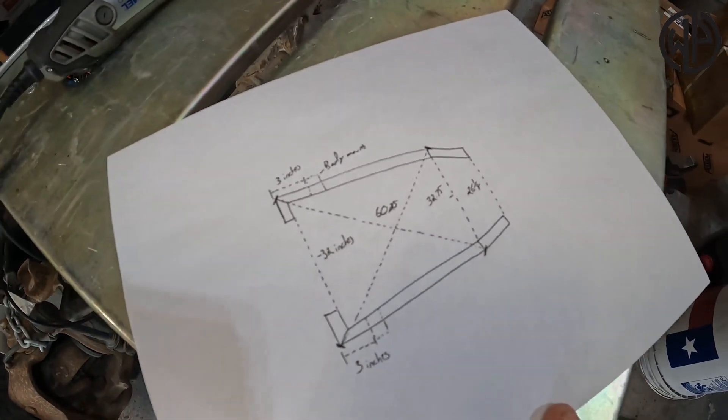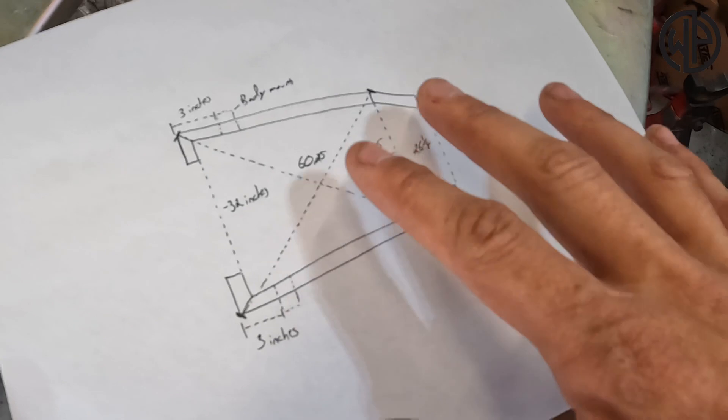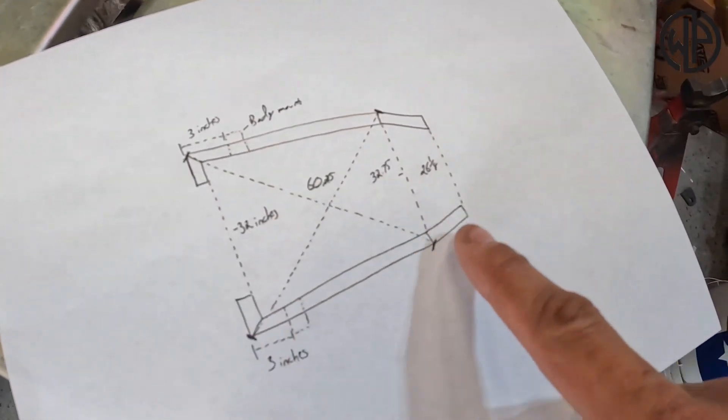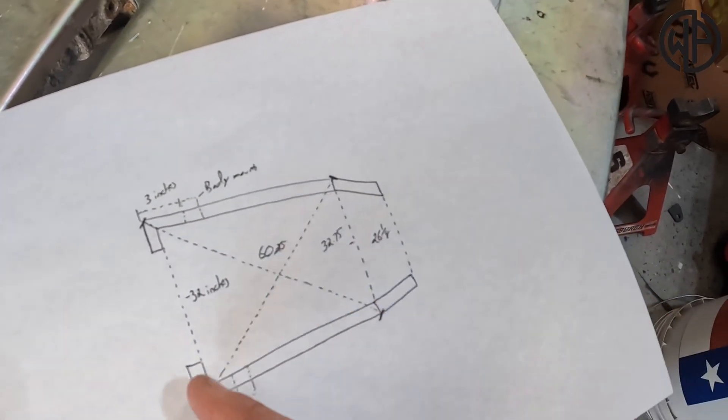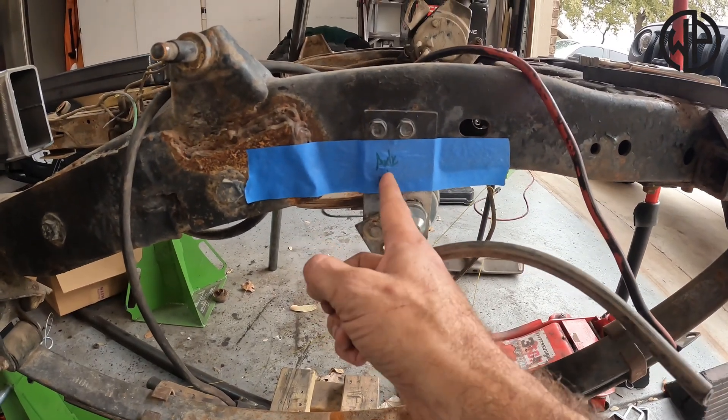We're back for day two of this frame build. Before I continue with the line level, I wanted to take a quick look at something super important — make sure that you guys write down all of your measurements. Here I have both sides of the frame that I'm making, with every single piece of tube drawn out with all of the measurements, corner to corner, ultimately keeping it as square as possible. This is where the frame is going to change, because not only am I going to move it forward and maintain that factory width, but I want to raise the front portion of the frame a little bit. I'm doing a pretty substantial axle stretch and I want as much up travel as possible. I've basically marked with some painter's tape to let me know where the original axle was.